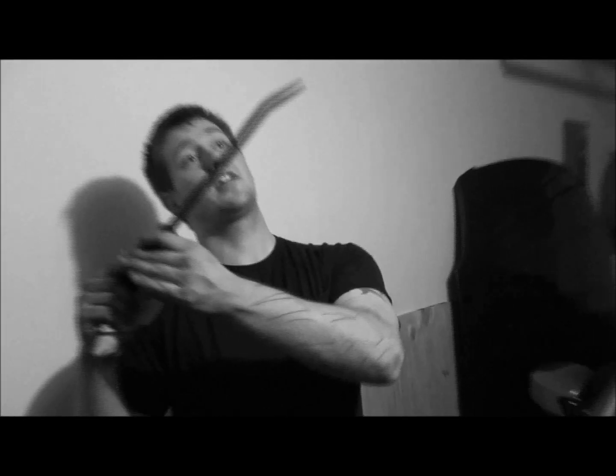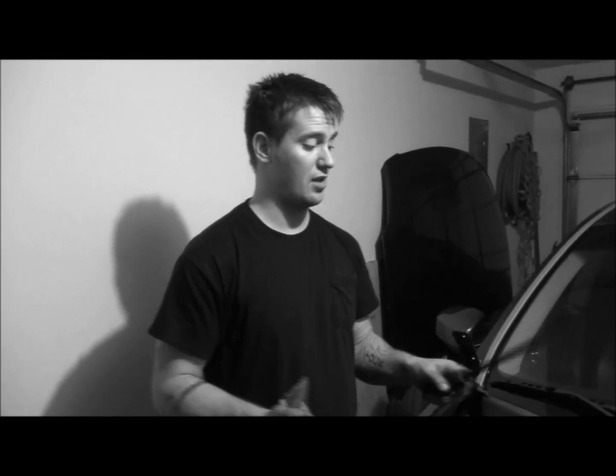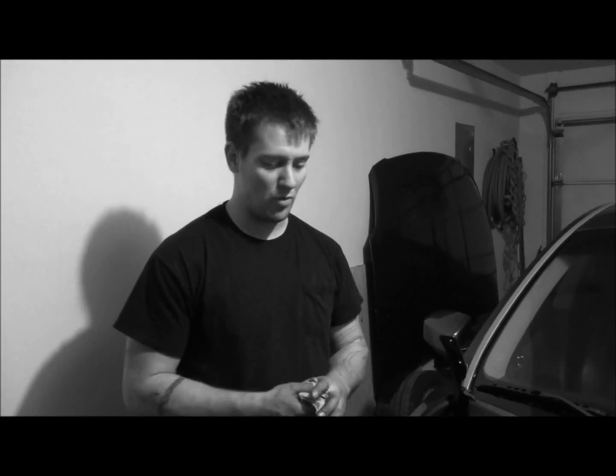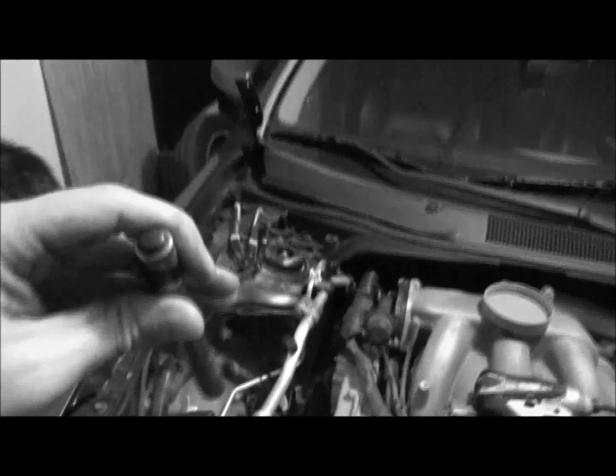Oh, I guess I didn't even point this out. The way we broke that loose, I told you I was underneath the car, pulled out the crank position sensor, and held on with this pry bar. I was laying under like this, so I went in at an angle, because you can't get a whole lot of grip on that flywheel. There's not a lot of it exposed. And what Michael did, how we fed that in, was we actually came in through the bottom.